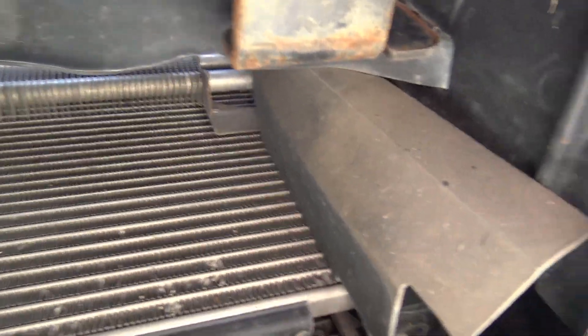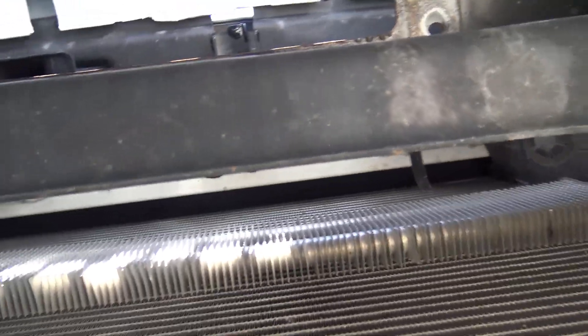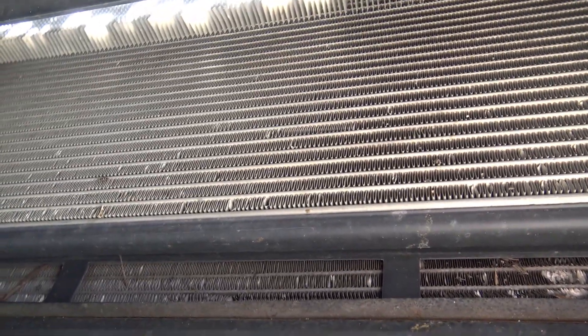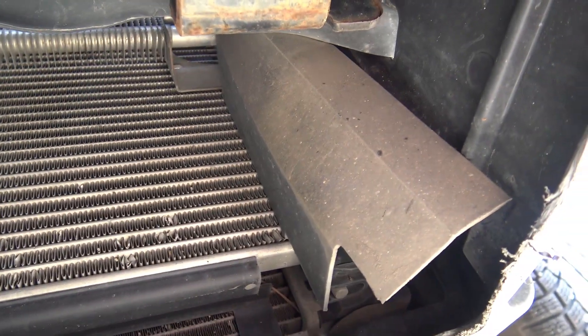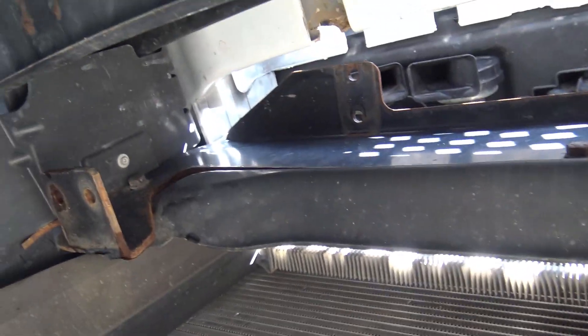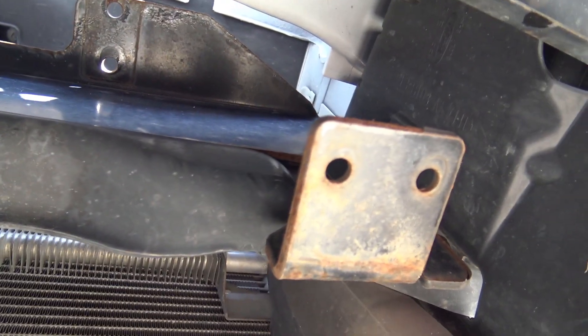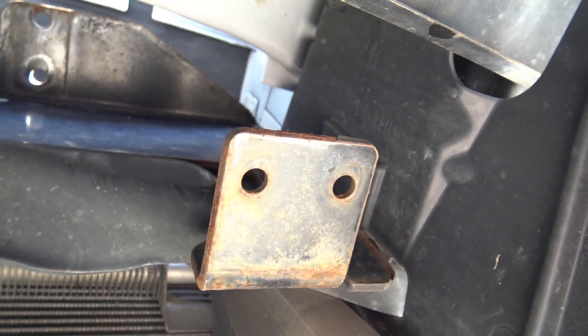Another very important thing to do when looking at the car at auction is to look underneath the front and at all the radiators. You can see right here we have the air conditioning radiator, the regular radiator, plus an oil cooler up there. Sometimes the fittings on the oil cooler leak — you can see the leak right there if it's present. This looks all very dry; I don't see any signs of oil leakage here at all. It's also a good idea to check the rebar brace in front of the radiator — you want to make sure it's not dented. This one looks nice and straight; no major collisions here.